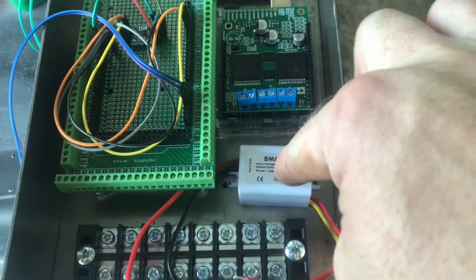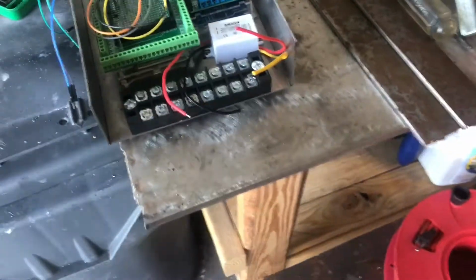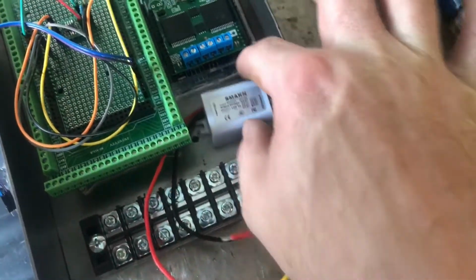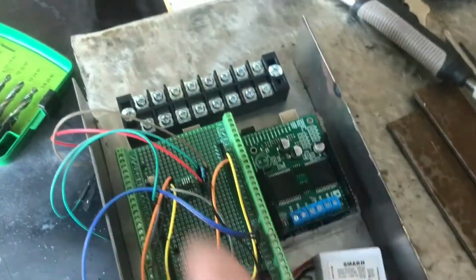That there's just a 12 volt to 9 volt step down, because I don't want to feed the Arduinos directly off of the car. It's supposed to be 12 volts, but sometimes it's 14.5 volts. Plus I'm worried about EMF when I shut things off. So I'm gonna run everything through there. If I melt anything down, I'll just have one piece to replace. I won't have to replace all these components and redo all the soldering.